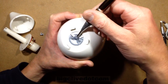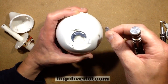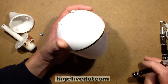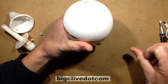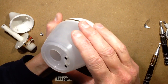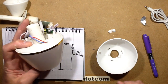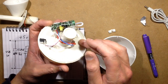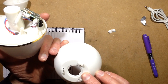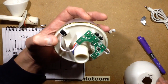The label says two watts, which roughly tallies with the power it was taking. The reservoir was twisting slightly so I tried to find a screw under the label. It's revealing just a plastic ring. The unit appears to be physically clipped together — the plastic assembly of the base has two recesses and the base just clips on. After some effort with a spudger it's open. The circuit is very common and very simple.